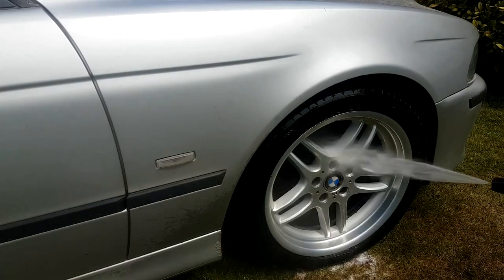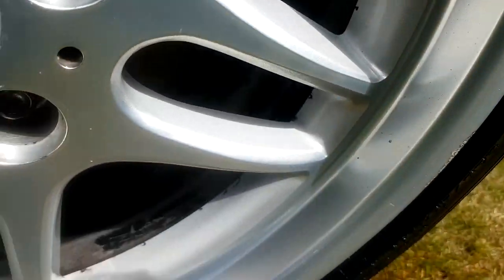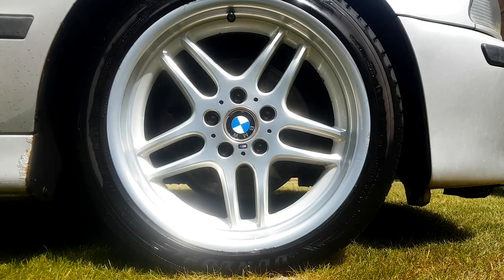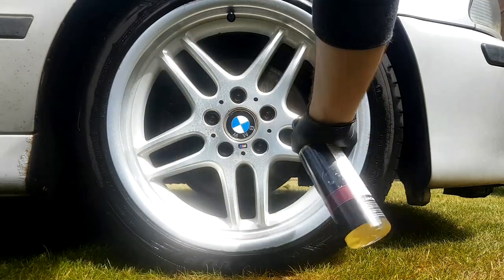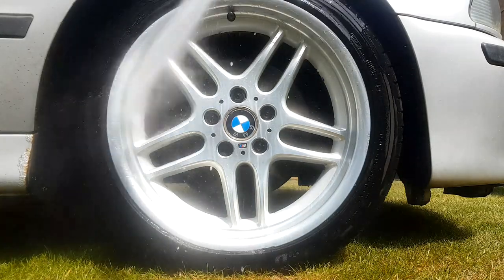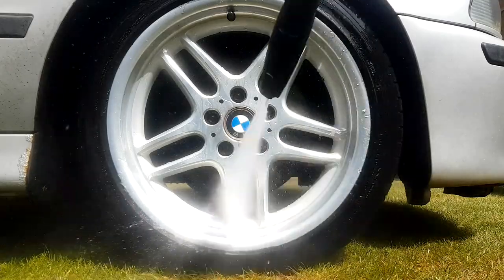In an ideal world these wheels do need a full and thorough decontamination - so that would be tar remover and claying, and then following that up with some polish - but in this instance that's not the plan for this video, so do bear that in mind for the finished shots. And finally I'm just going to get some protection put onto the wheels. I'm going to use the HydroSeal for this for simplicity - simple spray, dwell and rinse. You don't let it dwell for too long, just enough to let it get into all the areas, and then pressure wash off. You're going to see the water start to have more of a hydrophobic effect - it really just being repelled from the surface and showing the protection that's now been applied.